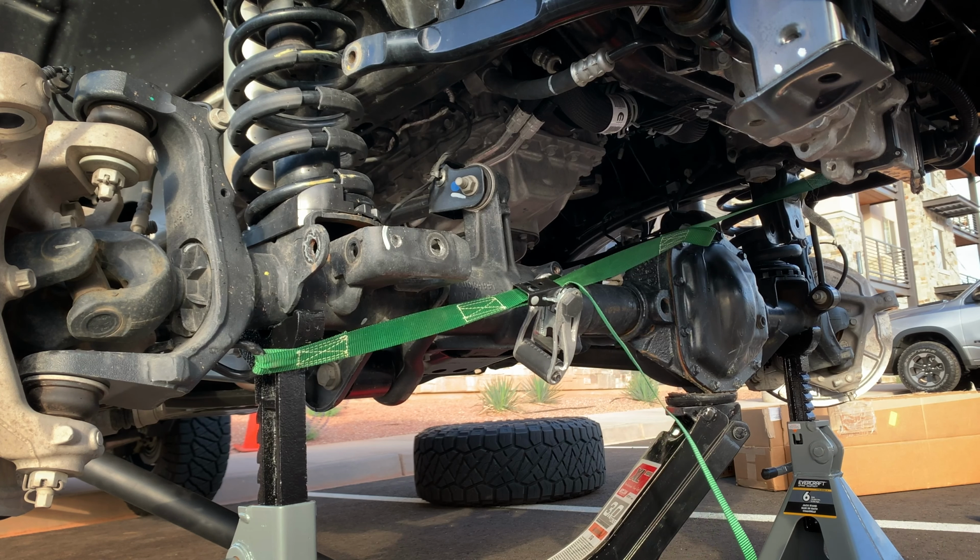Now we're assembling, length measuring, installing, and then torquing. And then we'll go out, well, we won't torque, we'll measure the front end and do an adjustment for the toe, because we've got our toe plates. And after that, we'll do our final inspection. We'll torque everything down and then go get a test drive.